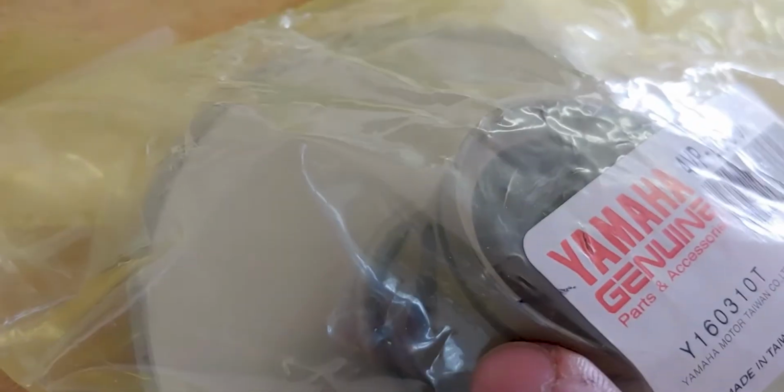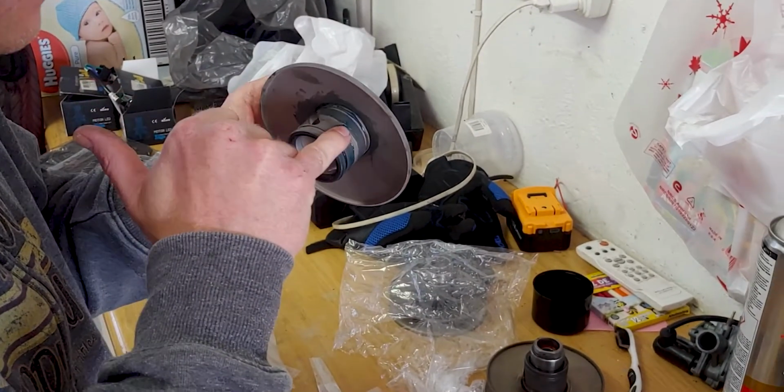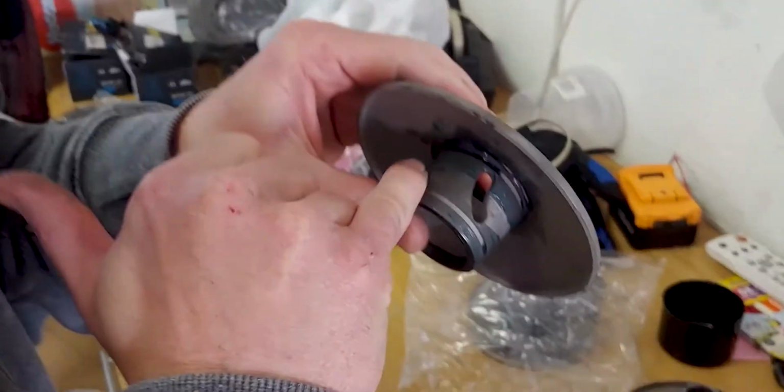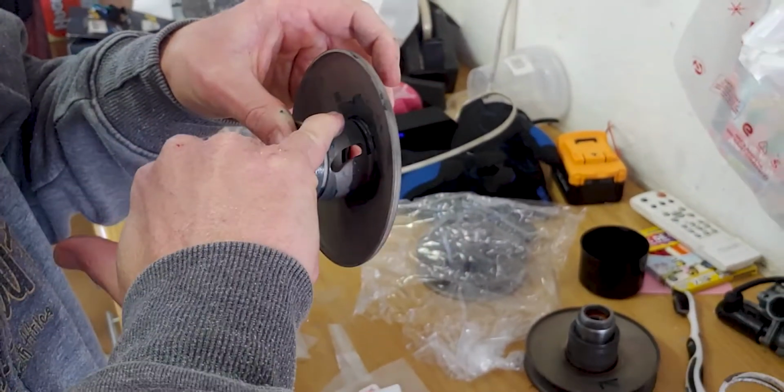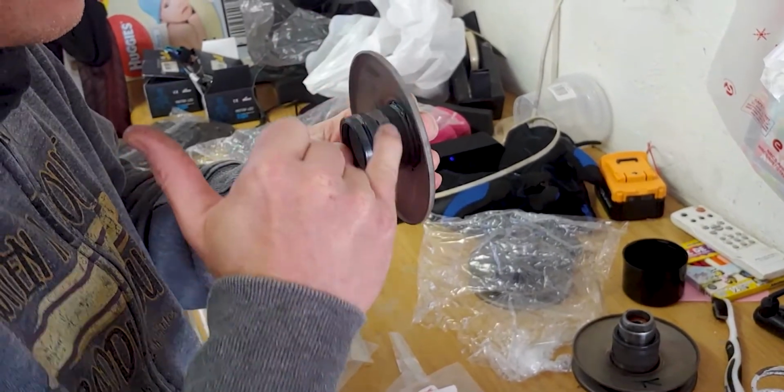Okay, new Yamaha parts. We've got 2 O-rings for the torque driver. There's the torque driver. The O-rings go in the bottom slot and that top slot there, followed by 2 new oil seals which go top and bottom of the torque driver, followed by 2 new pins. Alright, so the oil seals are in on either side of the torque driver, and Kev is just giving a bit of grease to where those little oil rings go. Obviously with sharp metal edges it can destroy very fragile O-rings, so just going to give it some lube and slide them on.